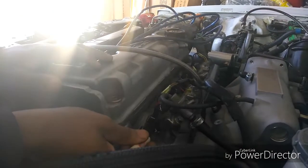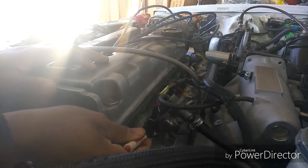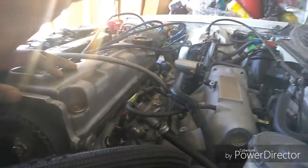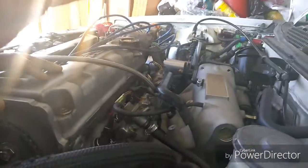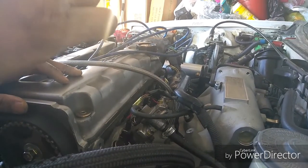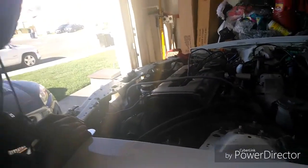So these are the stock injectors that came in the mail today. I got my stock injectors in — OBD1 — and I have a stock ECU in. A stock ECU ain't going to make the car run rich and foul out the plugs and all that kind of stuff. That's why I wanted to try to go back to something stock just to find out. So we're going to find out if it worked or not.